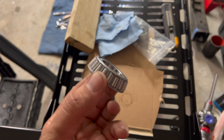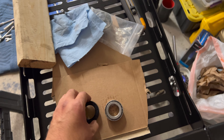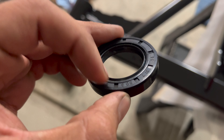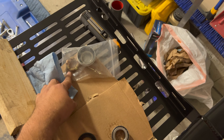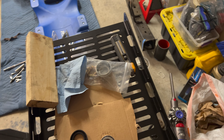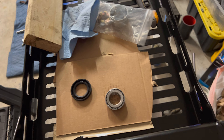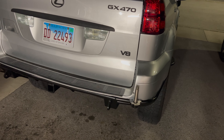Install the bearings on the swing out. I've got this up on some sawhorses — you've got a roller bearing. The smaller diameter side is going to go in from the bottom and then you have a seal that goes like this — this side goes towards the bearing. Do the bottom side first, then you've got a top bearing, a cap, and a crown nut with a cotter pin. We're going to do the bottom one first, then the top, slide it in, put the nut on, put the cotter pin, and then the dust cap. When putting the bearings in, grease them — I've got some molly grease and I'm going to put it on and then install it. Now that the bottom bearing and dust seal is installed, I will take this swing out, install it on the spindle, and then put the top bearing in.